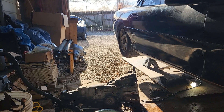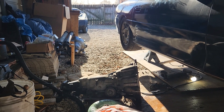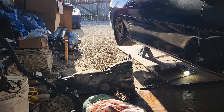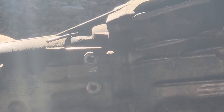We've got to get the torque converter into this one. When you stab the torque converter, make sure you spin and twist until that thing goes back three clicks — it should go back three clicks. I wasn't sure if this transmission's fittings were going to fit the turbo 350 as push-lock ones but they fit. We'll have to do some transmission line bending to get them to go in there because they're angled down whereas this transmission has them coming straight out the side.